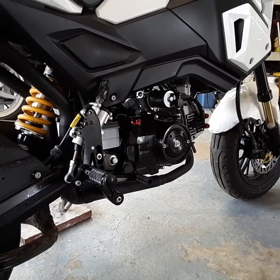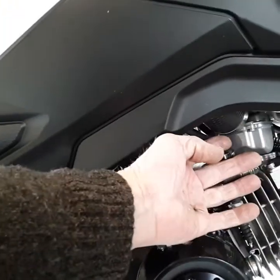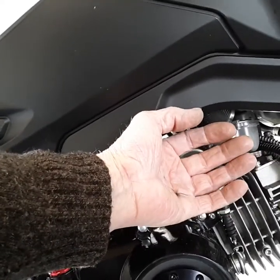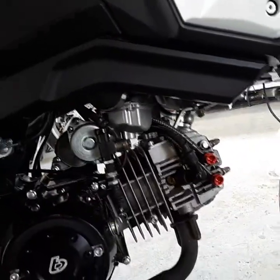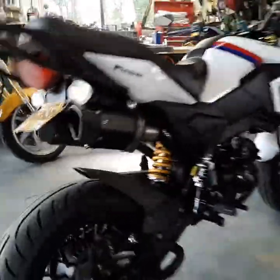So, carburetor tuning, there's a lot to be said about this. You have your idle circuit, you have your tip in, and you have your mid circuit for mid-range, and then you have your full throttle circuit. And each one of those circuits is tunable. So anywhere in the RPM band, anywhere in the throttle, you can set the bike so that it's not running too rich or too lean. And it makes them crisp. It makes them run nice and clean.